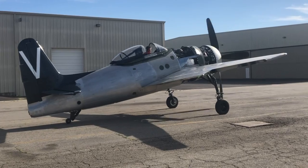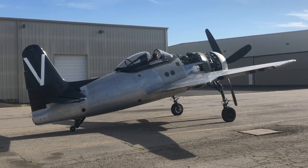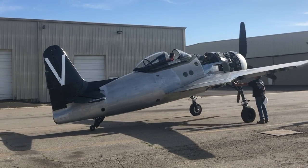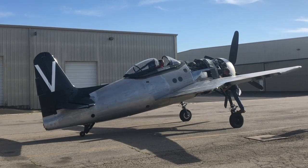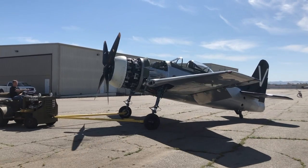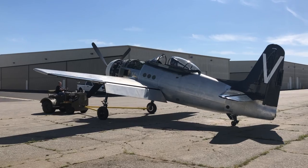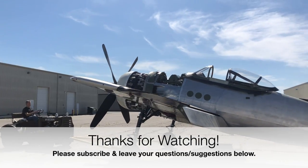Other than guns, ammunition, and old World War II radio equipment, it's pretty well stocked. We might have to put some lead in the tail — which is common. We don't have the full tail hook mechanism, which is about 90 to 105 pounds back there, so that could be a reason to add tail weight — but we won't know until we weigh it. We don't like to run new engines on the ground very often since they've already been test-run and we don't want to overheat the cylinders. We've run it six or seven times now; last weekend we did a full-power run with the tail tied down — the final check. It's ready to fly. A lot of work, and here it is — it's breathing, it's alive.